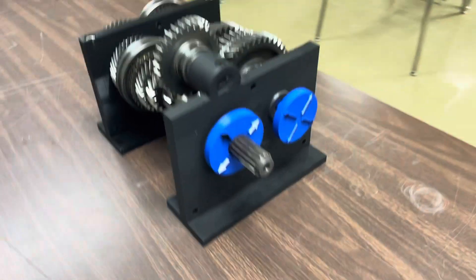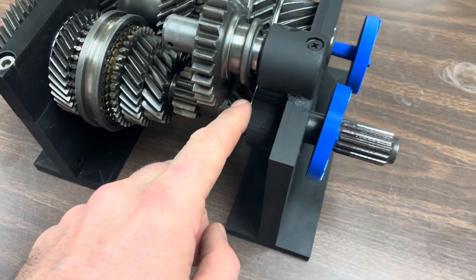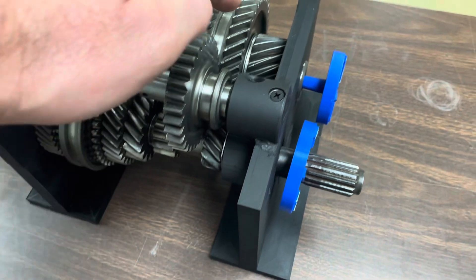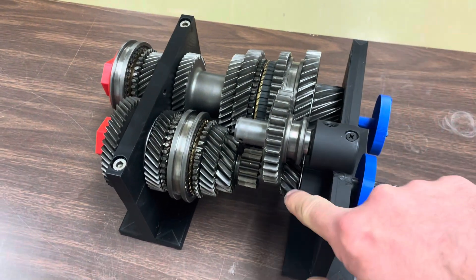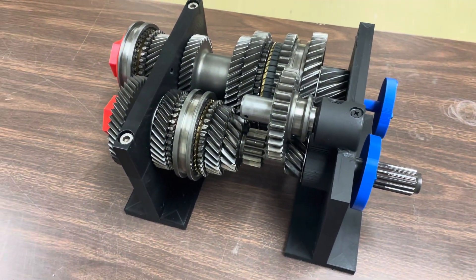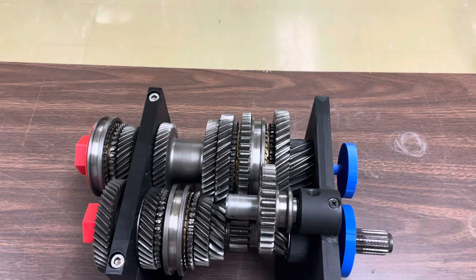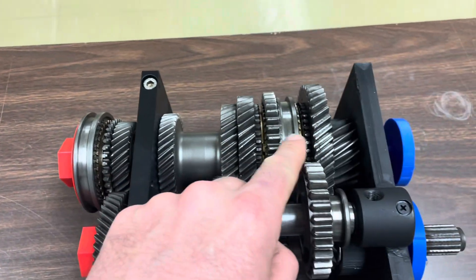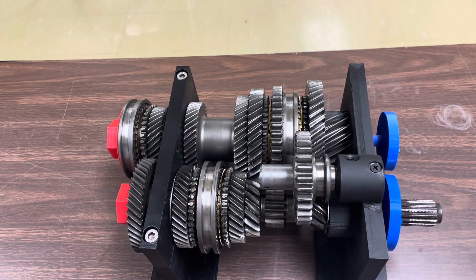You can calculate the actual gear ratio for first gear by counting the number of teeth on the drive gear, because this gear is driving that one. The power from the engine drives the drive gear, and this would then be the driven gear. The way you calculate gear ratios is you take the driven gear and divide it by the drive gear — the number of teeth on this gear by the number of teeth on this gear — and that will give you the gear ratio for first gear. We're going to go back into neutral. All the shift forks have to be in neutral for you to have neutral, and at any given time there can only be one shifter that is in a gear, or things just bind up and seize.